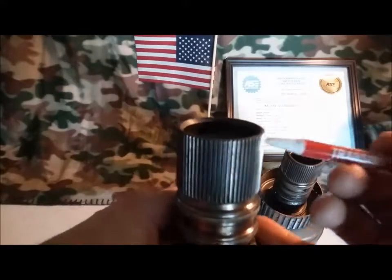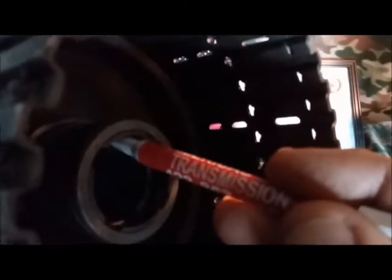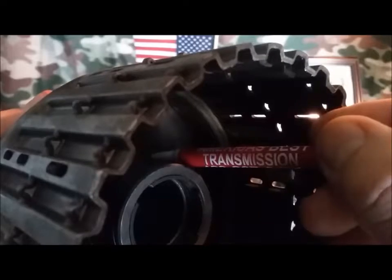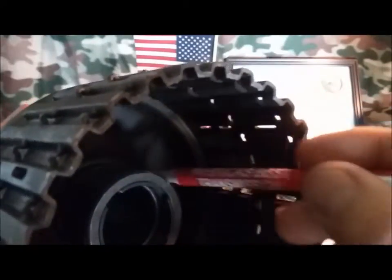This is actually the first and the second drum. It has no taper here, and is commonly referred to as the thrust washer type because it has four little reliefs right here to hold the tangs for the thrust washer that sits right here — not a bearing. It also has no inner caged bearing here. The difference between the first and the second drum is that this inner lip seal down here comes in two variations: a thick one at 0.233, or a thin lip seal at 0.106. You have to have the drum that accepts the thick lip seal for the thick one, and the drum that accepts the thin lip seal for the thin one.